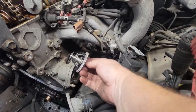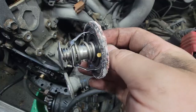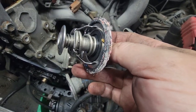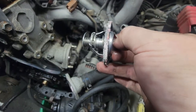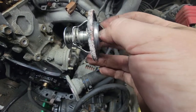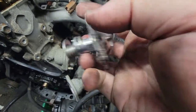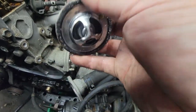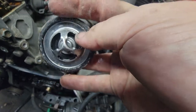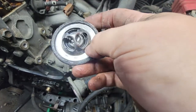When I took out the thermostat, I noticed this white bead going around. I believe this is going to be head gasket sealant — some people use it as an aftermarket sealant to try to seal the head gasket. If it's not that, then that is just a whole bunch of corrosion that is building up, which is not good. I'm thinking it's some kind of head gasket sealer that someone tried to use at one point.